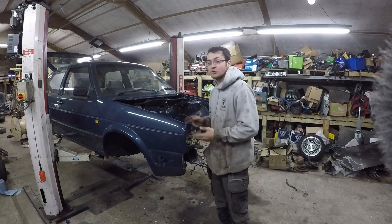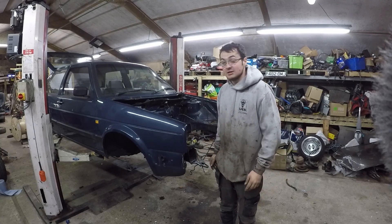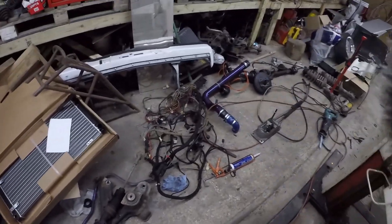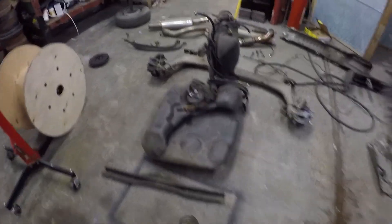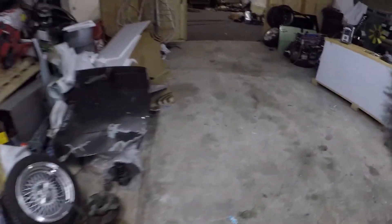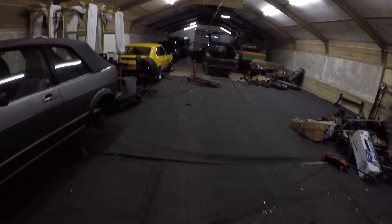Things have changed a tiny bit — I haven't recorded anything, I've just been flat out here going for it, trying to make some progress. You may notice the car on this ramp has wings and it's a different colour, because it's the other one. What I have done is finished off stripping out the wiring, steering racks, subframe, rear shocks, fuel tank — which is actually like a full tank of fuel — rear beam, and exhaust. I managed to use the engine crane and the engine stand to move my old shell down the end of the shed, then get the new shell out onto the ramp using the dollies I built a while ago. Got the shell on the ramp, and managed to put the dollies back on the old shell so I can move both shells about.